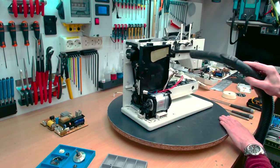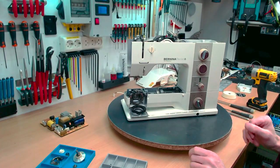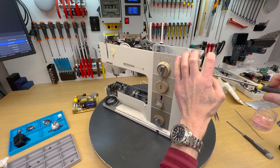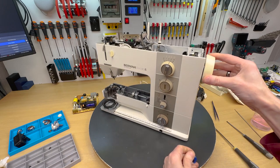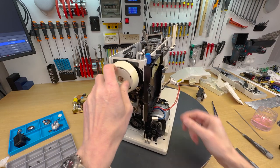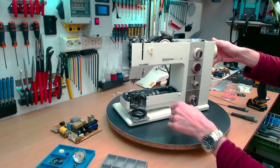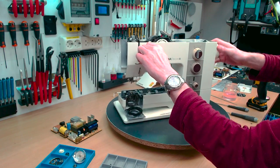I remove the hook drive to be able to see everything behind it and to clean it out. Back with the hand wheel — this machine has a sleeve behind there with the hand wheel, which is the needle stop function. When you remove the top of the machine, the bobbin winder mechanism is removed, and then you're not able to turn the hand wheel freely. So I have that little 3D-printed tool that I clip in, and that makes me able to turn the hand wheel freely.